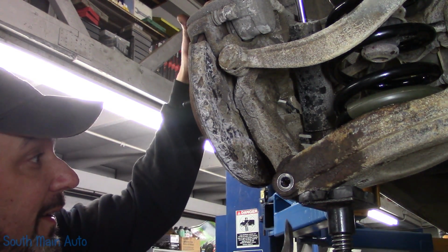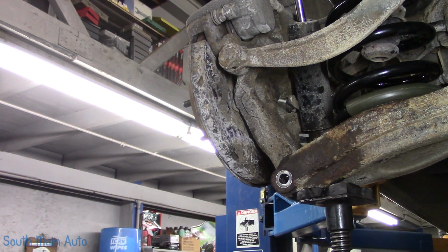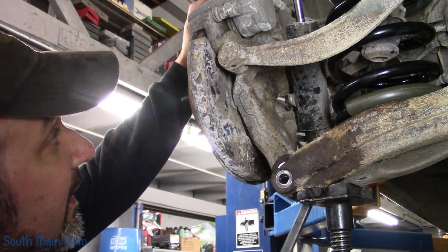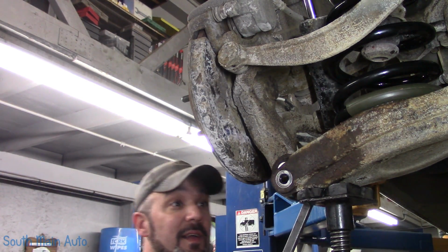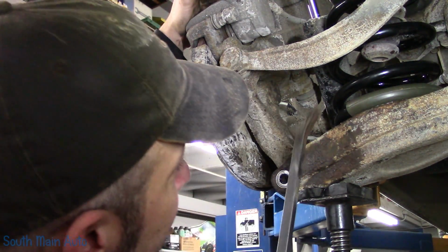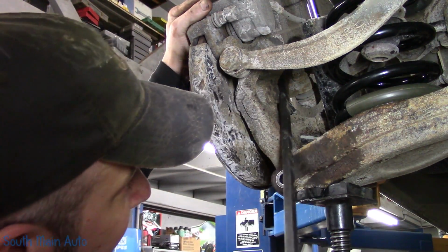I keep calling it a control arm, a knuckle. Knuckle. Alright, our jack is maxed out, so we should be good because that's where we started. Should be being the key word. Probably because all the factory bushings still have some twist in them. When we come down, I think it naturally wants to go in. I can't really pry against the backing plate. If I get a hold of anything up here that's not crusty.